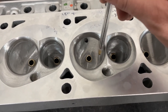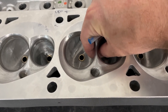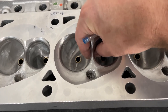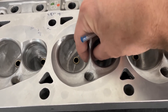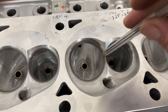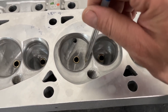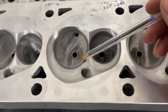So it's 210 on the bowl. Next to no material removed from here, because on Ford heads between the two intake and exhaust ports on any aftermarket or stock Ford head, there's typically not a whole lot of material. This one measured at 95 thousandths, so I for sure didn't want to take any more off. All I've done is blend the valve job and then just cartridge rolls on this side — more of the bowl area comes from here. The throat is bigger, but I won't tell you exactly what I did.